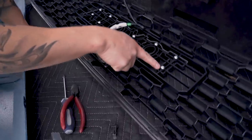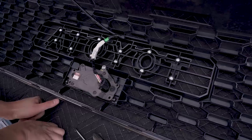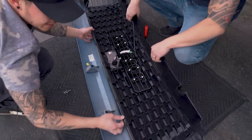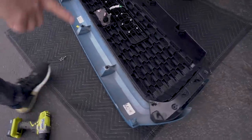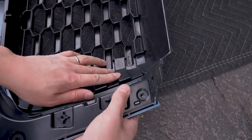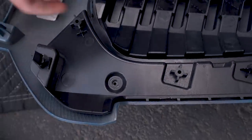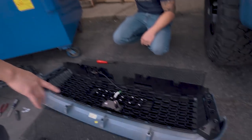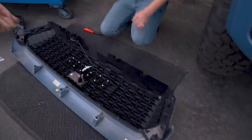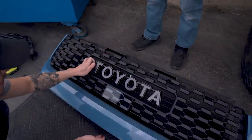Since we're back here, we'll show you guys how the letters are secured — they are separate from the grill but secured with screws from the back. Let's go ahead and put it to the lower grill piece. We're just kind of lining it up with those tabs; it should be pretty easy. We're going to start on one end, find that tab right there, and then this piece will just clip in. You can see it kind of locks itself into place — that screw hole lines up with that. Once we have everything clipped into place, we are going to replace those four screws. This part's pretty self-explanatory, so we'll just zap these in.